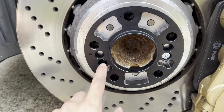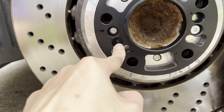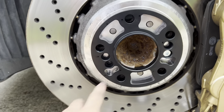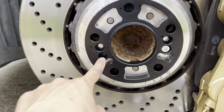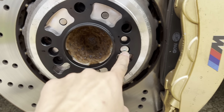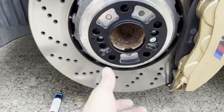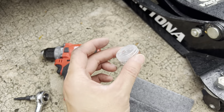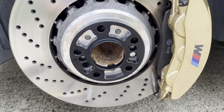To keep it transparent, I mushroomed one, so I need to get that drilled out. That was stupid. I guess I forgot to use some PB Blaster before I unscrewed it and that one stripped. But anyways, this one went in perfectly fine, didn't strip it. Did 16 newton meters, which is the spec. And I used the anti-seize on the bolt and on the back of the spacer. Should be good.